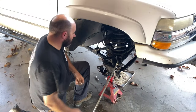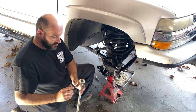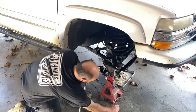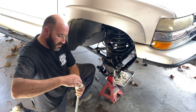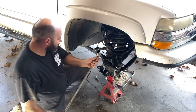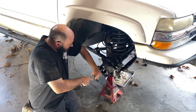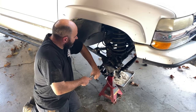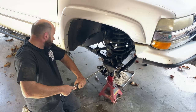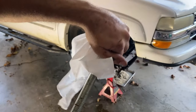Pipes. I remember what that big washer was for. You take this, chase that thing down, and put it on the end of this tube. You can run it down the axle tube, push down on the axle tube, and drag all that crud out. That is what you'd be dragging through your seal if you didn't pull this out.